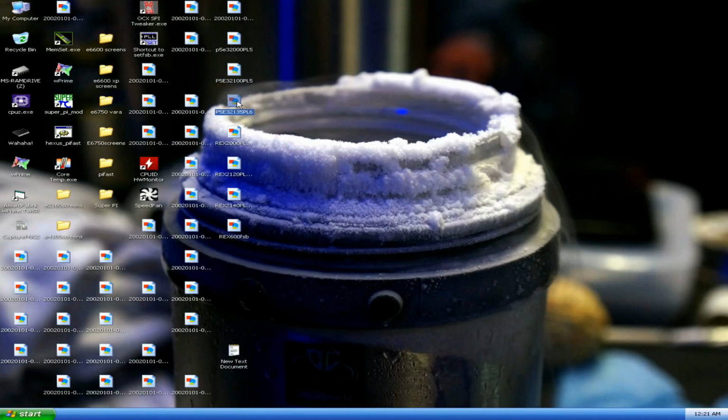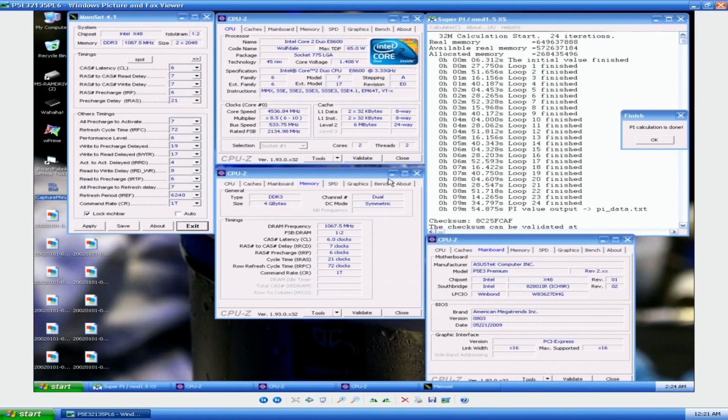Now when it comes to the performance level 6, the maximum frequency was somewhere around 2133. I was hoping for at least 2140, maybe 2160, but I think it's quite good. But the same thing happens even at this frequency level. I had to post much lower Northbridge voltage than what the actual test requires in order to run stable. So in this example I had to make the initial post with Northbridge voltage of like 1.59, 1.61, then raise the Northbridge voltage up to 1.71, 1.73, and boot into the operating system with that voltage and run the test.